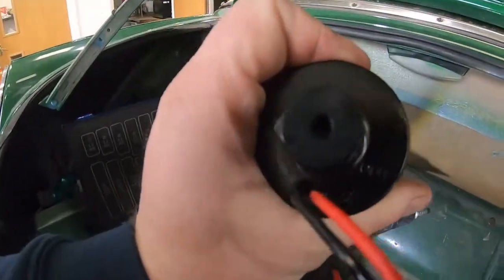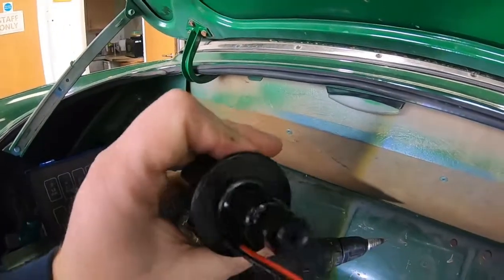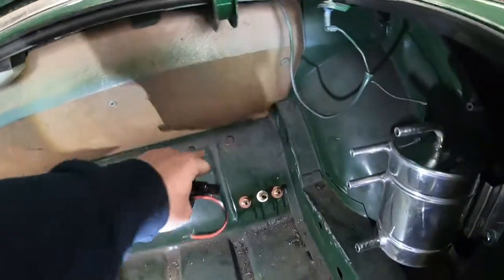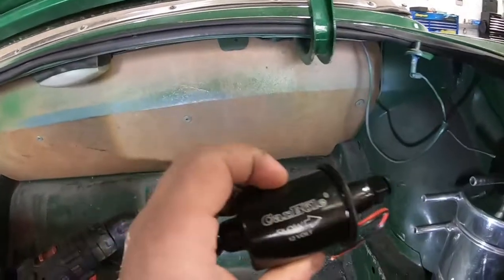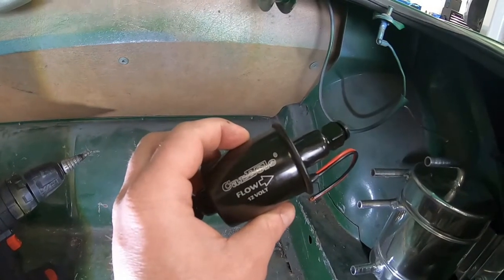It does have 'out' marked on there — so that's what I was looking for, whether it has 'out' and 'in'. This needs to be mounted ideally within 30cm to the bottom of the tank — anywhere below this line here. It also says 'flow' on the side, and it ideally needs to be at about a 30 to 45 degree angle. There's also a little filter that filters fuel going into that pump. We've got the main filter which will filter the fuel coming out of the high pressure pump. I wanted one before the high pressure pump, but a 12mm or half inch hose is a strange size to find filters for, as it turns out.